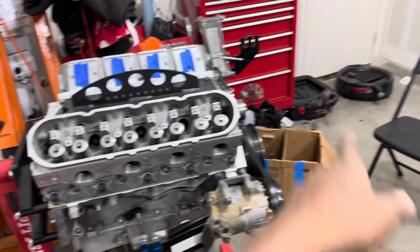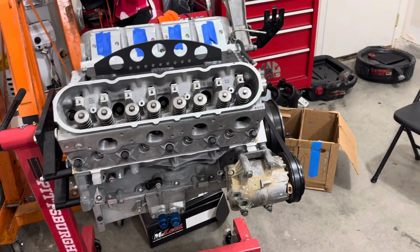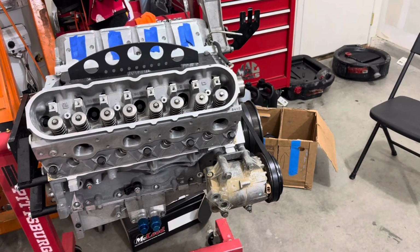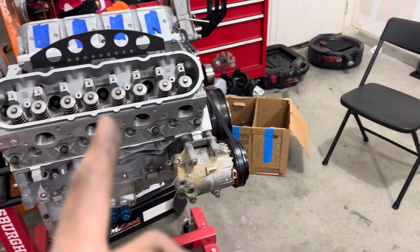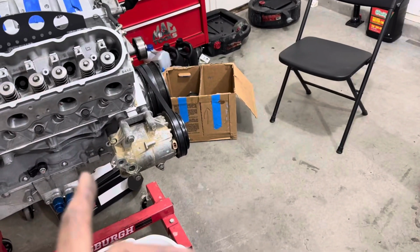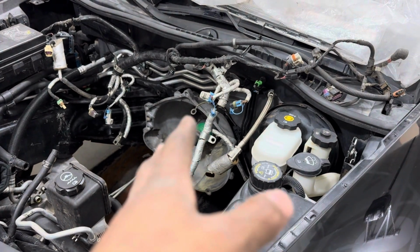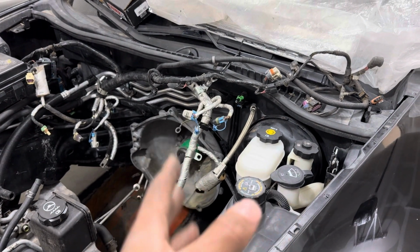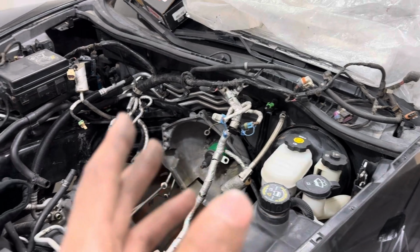And got our motor mounts over there. So stick those guys on. And well, actually, I got mixed feelings about those. In my head right now, how I want to do it is I want to leave those off. Fish it down in there without the motor mounts, which doesn't look all that fun on this side. But what I wanted to do was to use the room of not having the motor mounts on to fish down in there to basically get it to the motor, the torque tube, and spline it up, get it lined up, and then get some bolts in it, and then stick the motor mounts in it.